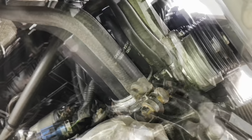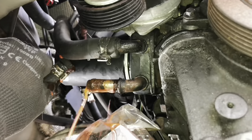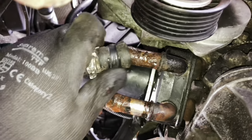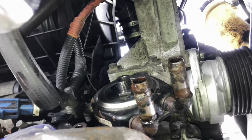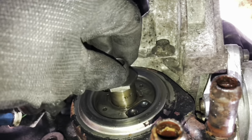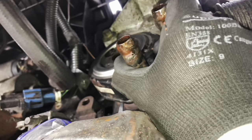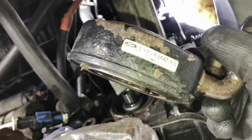Under the coolant hoses - I forgot about that, right, get the rag. Okay, so that seems to be a piece of the engine that doesn't drain. Same with the other pipe. Take the filter back off and then with a 27mm deep socket undo the middle nut and take off the cooler. There's no easy way to do this without getting covered in antifreeze.